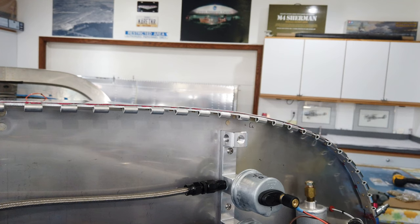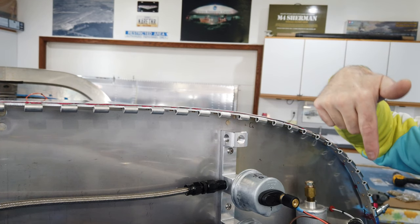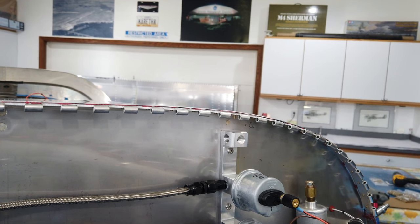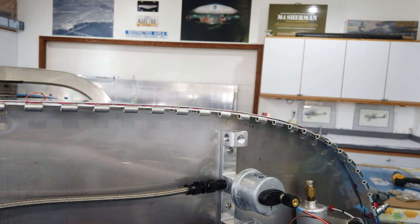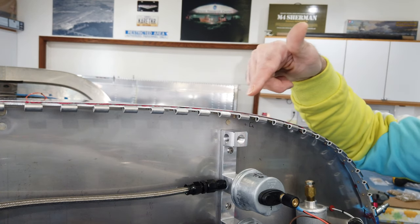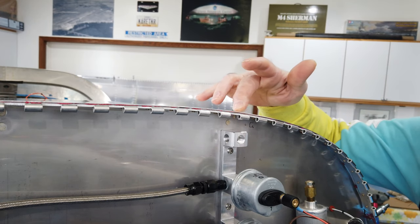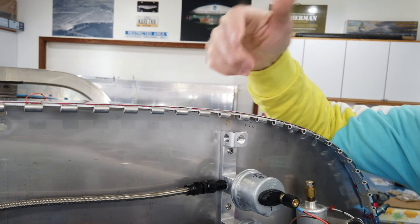I've used this technique before - off camera, down the side of the fuselage on these side hinges. I had to take the hinge out, drilled out the rivets, pulled the hinge out, put it back in and re-rivet. That was difficult to do with the engine mount in the way down at the bottom corner where the gear leg is - you can't get a squeezer in there - so I used this method and it worked really well.